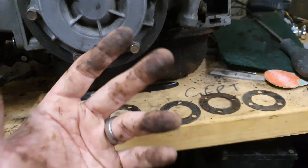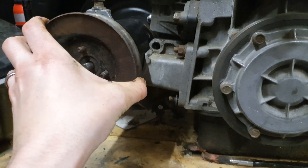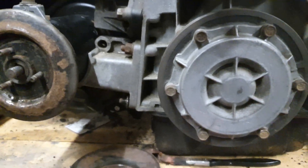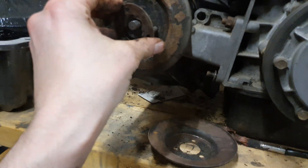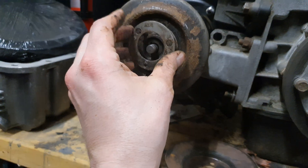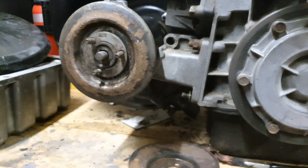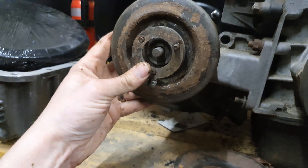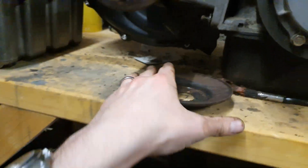You can buy them separately, but they came with a whole bunch. If your belt is too tight, all you do is take the outer pulley off and fit these washers in here, which effectively act as spacers between the inner part of the pulley and the outer part. I'll just jam a whole bunch in there so you can see the effect.